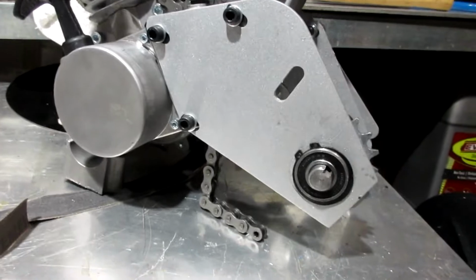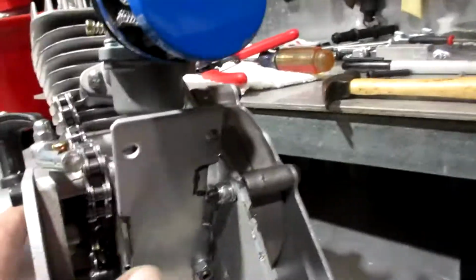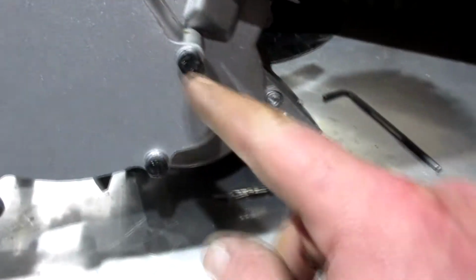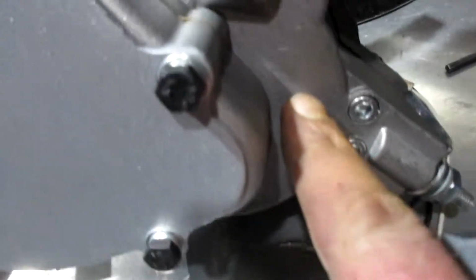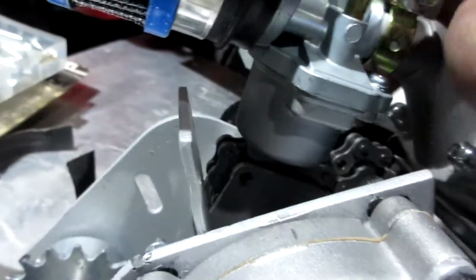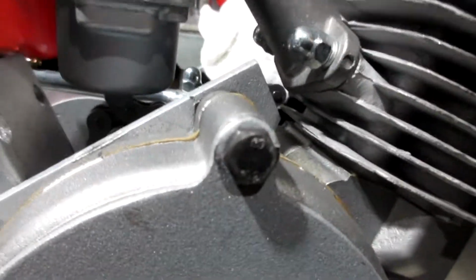So it looks like from this side, this is bad news. So here's another thing, I don't know if it'll work, but they have a centrifugal clutch kit for these, and it gets rid of the clutch. You leave it all in place and you just dismantle it from inside, and the centrifugal clutch goes inside of here. And I considered that kit. That might be an option. It would be nice to not have a clutch. It would just be, you know, like you start it and it would just be sitting running until you gave it gas, and then it would take off. That's an option.